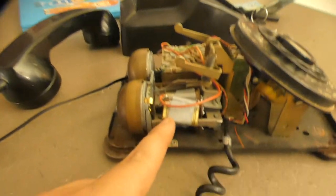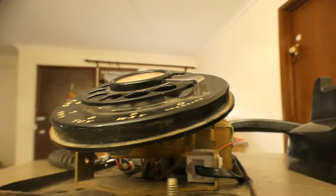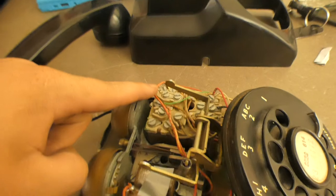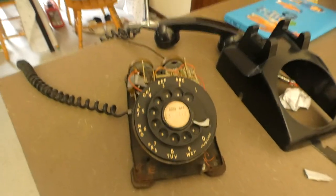That's the bell capacitor right there on this phone — I made the bell ring underneath the rotary dial. As you can see, I put an RJ11 clip here, so I can plug any modern day line cord into the phone and the phone will work. That's not connected permanently — I've got the line wire here and the ring wire here, which just connects into our Aussie system.